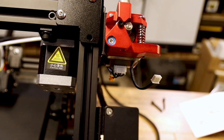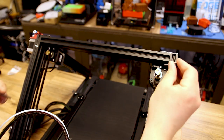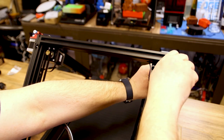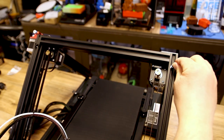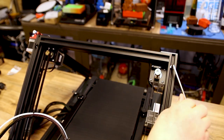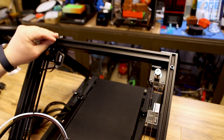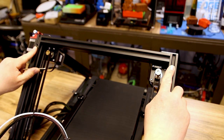There's a hole on this side and the other side, and those will be attached as well. Take the M5 by 45 screws, push them down through here and get them screwing into the extrusions below. You should feel them bite in — don't over-tighten, but make sure they're good and tight. Once started by hand, grab the big Allen wrench, use the small side, and tighten them down. Leave them just a little loose for now so we can make adjustments when we do the bottom corners, then come back and finish tightening.